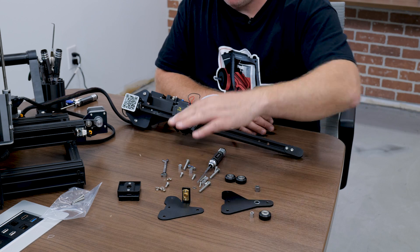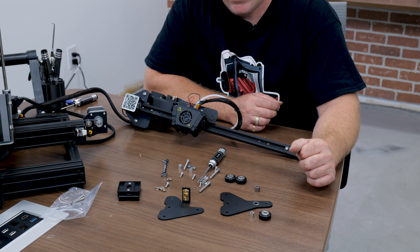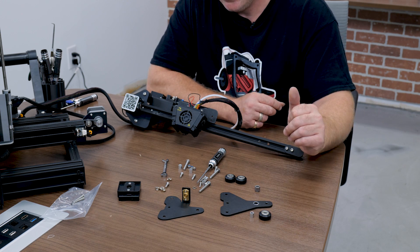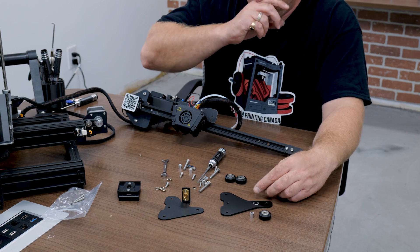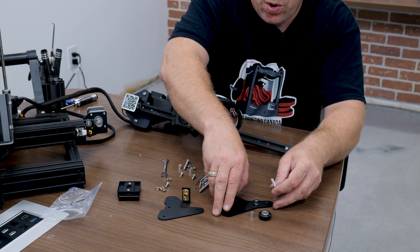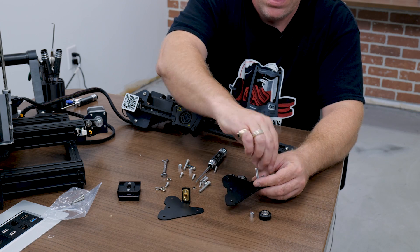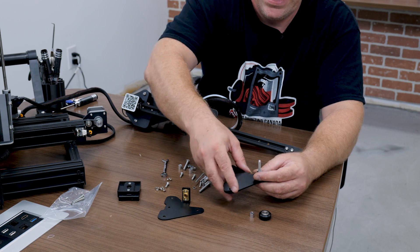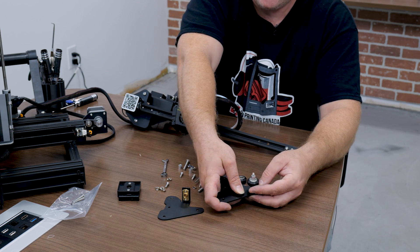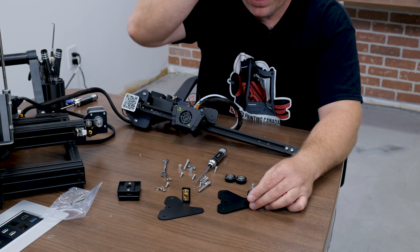Now that we have all the parts laid out on the table, you have your main plate which is going to stay the same. We want to make sure we assemble this the right way. The first thing we're going to do is take this eccentric nut and the longer bolt they provide in the kit — you're not going to be using the standard bolts anymore. That bolt will go through, your eccentric nut will drop on, then your wheel, and then a spacer. That's step number one.